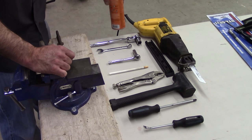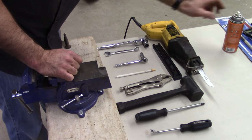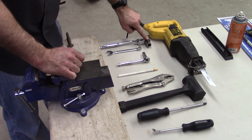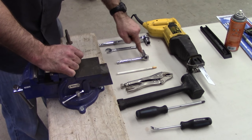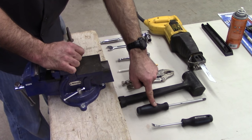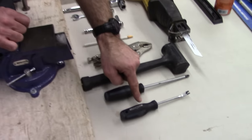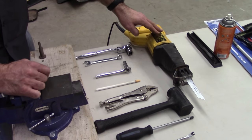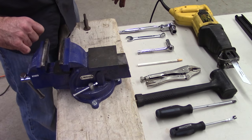The tools we're going to use for this install: a silicone lube or any other style of lube like WD-40. We're going to use the back piece of the slide that we cut off to hammer on the new slides. We've got a 16mm socket with a 16mm wrench, 10mm socket and wrench, a marker, a pair of vice grips, a hammer, and a large size Phillips screwdriver. We also used a pry tool just to bang off the old slides. And we've got a reciprocating saw and either a buddy or a good vise to hold your slides.